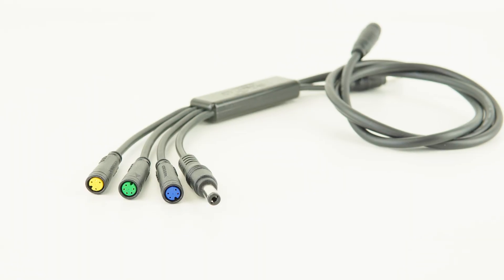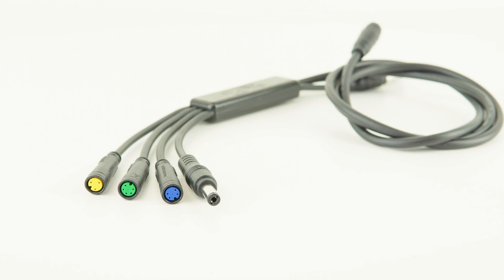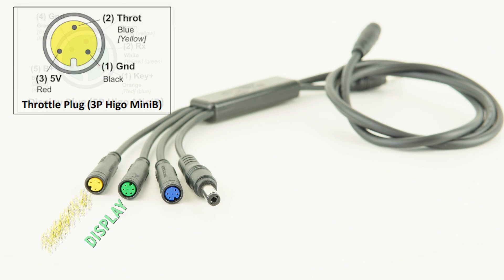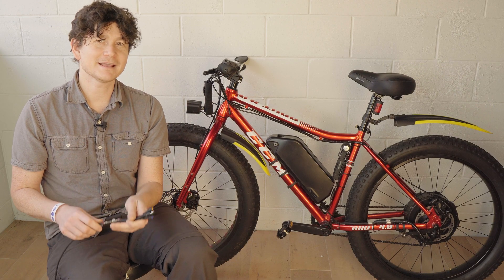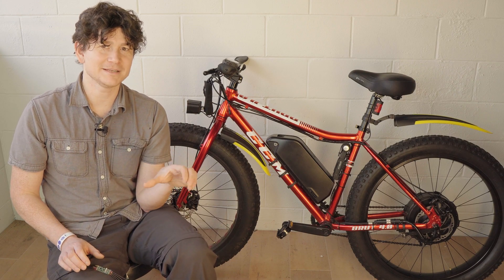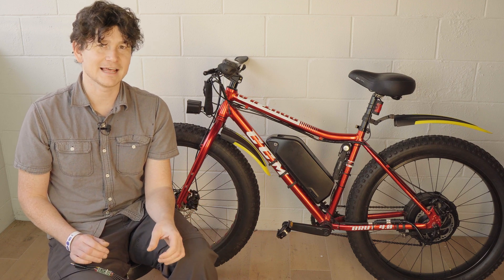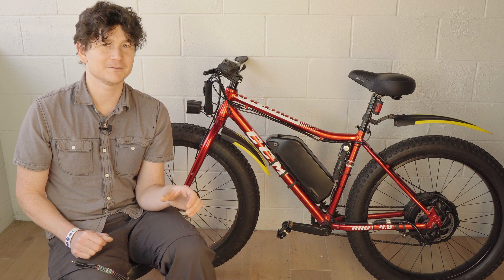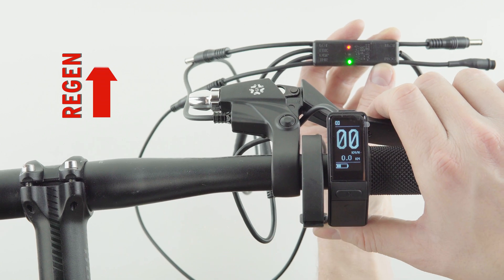The Super Harness has three different input plugs: one five-pin plug for the display, a three-pin plug for the throttle, and a four-pin plug that has both digital and analog e-brake input lines. If you have a bike set up with simply a common digital brake cutoff lever, it now behaves like it does with a Cycle Analyst — squeeze the brake and you'll get a baseline amount of regen around 25 percent. Your throttle then becomes repurposed to control and increase that regen.